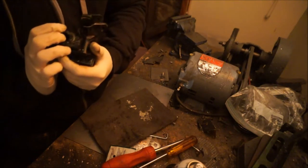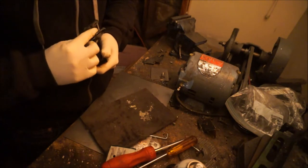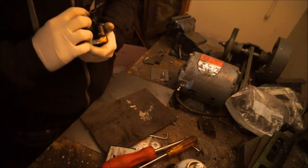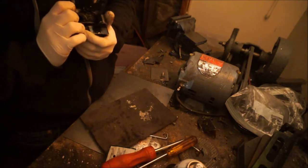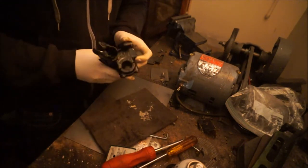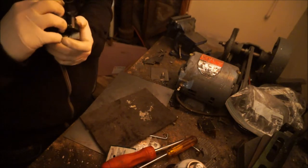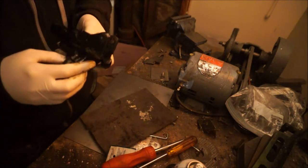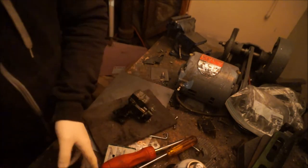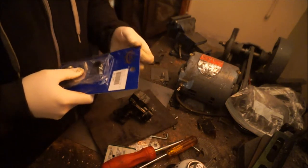Now, how do I get the piston out? I think there's usually a circlip or something holding this guy on. I still don't think that the master is the issue because it had the other master cylinder on from the FZR and same issue. So I still don't think it's the master, but that's obviously worth replacing. I'm not going to struggle with this too much when I could just easily go look at a parts diagram. Let's see if it's easily apparent to me — maybe the rebuild kit can give me some clues as to what exactly needs to get replaced and in what order.